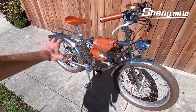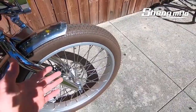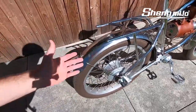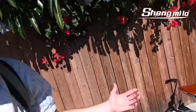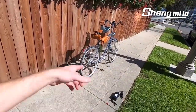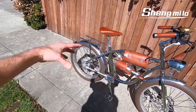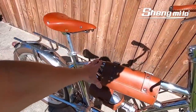I think it just matches the aesthetic of this bike. Look at these very thick 10-gauge spokes — I'm used to only seeing up to 12-gauge, and usually only on the rear wheel to handle the forces of a hub motor. This does have a hub motor, 500 watt, and they say up to 90 newton meters of torque, which seems like a lot — normally motors give you around 50 newton meters. This one is a 250-watt motor, a little bit lighter, probably seven pounds, and this one is probably about nine pounds.